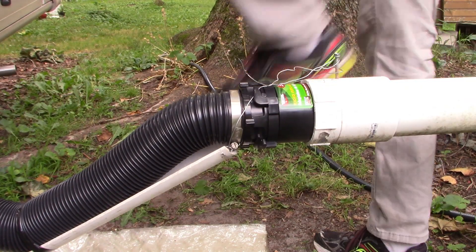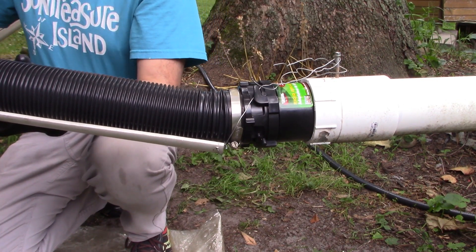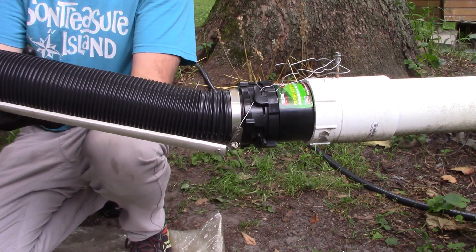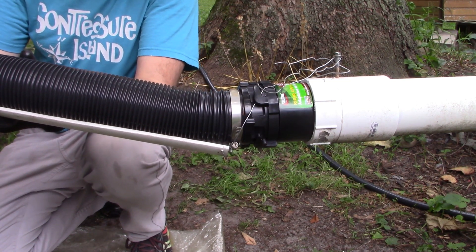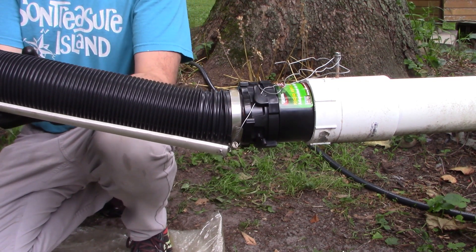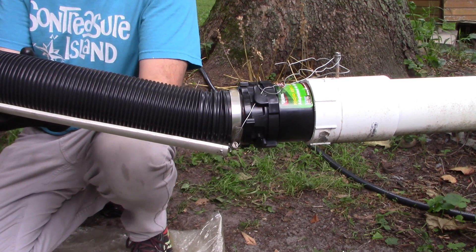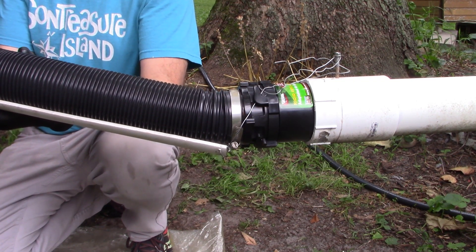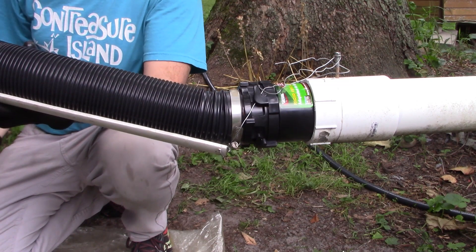You're joining me trying out this new connector for the very first time. I'll sit here and support the hose as the tanks drain. You can hear the waste draining now — and happily I've got a nice dry, non-leaking connection as the refuse goes where it's destined. Always drain the black tank first — that's the toilet waste — then drain the gray water, the sink and shower waste. This is a really convenient setup for me.